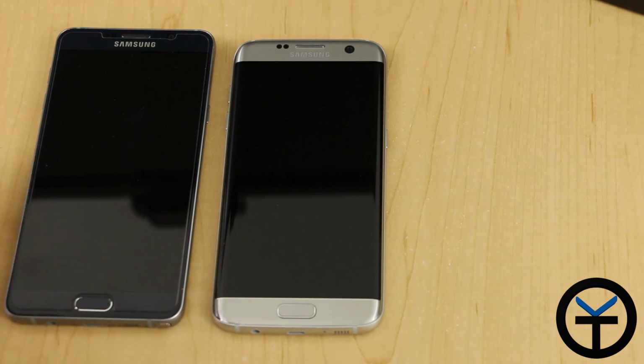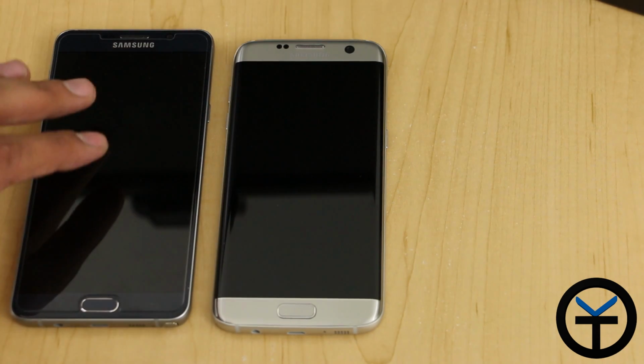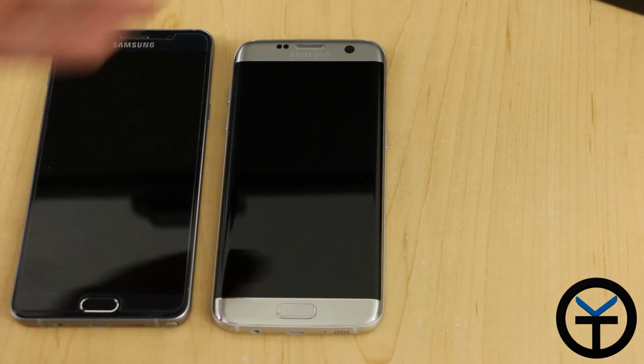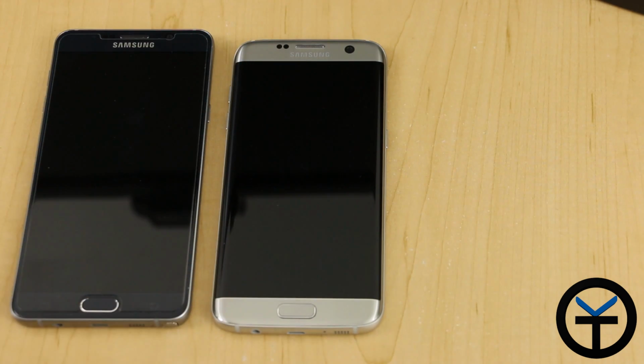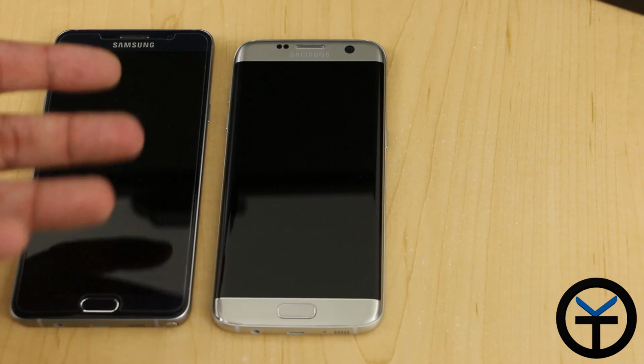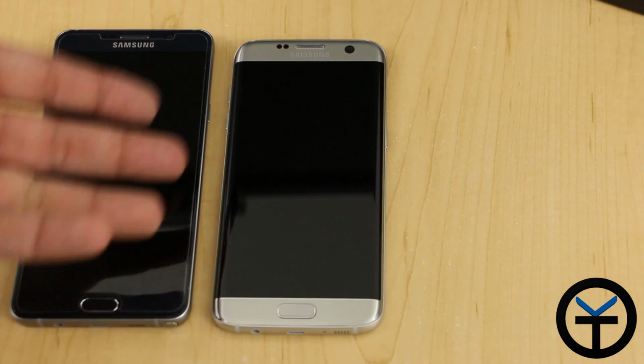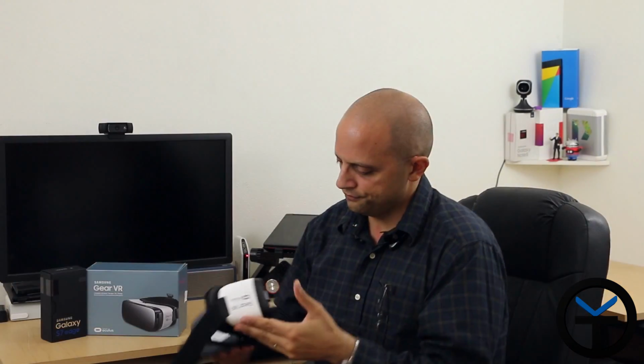We still have the same technologies as far as quick charging. So we're able to use quick charge technology for wireless charging as well as quick charging using the direct plugs at the bottom. Unfortunately, we do not have Quick Charge 3.0, even though we have it here, because we're limited to USB 2.0 on the unit itself. So we're going to get quick charging, we're going to get Samsung proprietary, but still, the jury's still kind of out as to why they didn't decide to go with A, USB Type-C, B, Quick Charge 3.0.